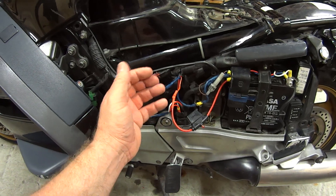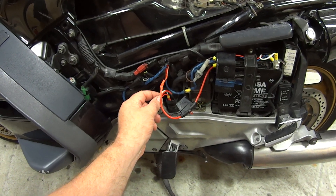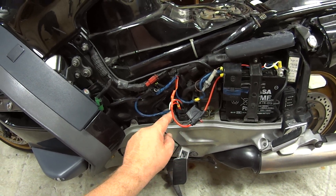This wire here melted through and obviously melted the coating — the insulation — of all the wires, which caused the bike to stop. Since then I've put in heavier gauge wire and new plugs, still onto the same old relay. It still works, and I do have a new one in the mail.